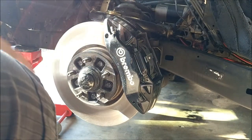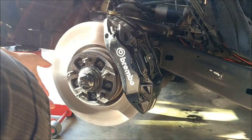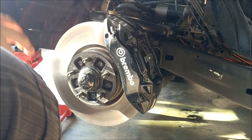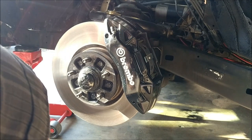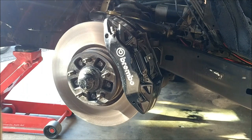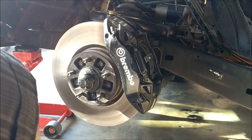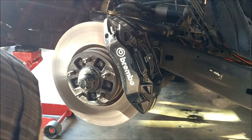And the rotors here — these are actually EVO 9 rotors. They were modified to work with the stock hub. As you can see, the hub actually bolts onto the rotor rather than the rotor going onto the hub. So I'll show you guys the stock rotor so you can see the modifications that were needed. This is the stock Toyota hub and this is an EVO 9 rotor — 12.6 inch — that I got from CZeroMedia. He had the best prices. These are Stop Tech rotors and were the best price I could find — even generic AutoZone rotors were more expensive.